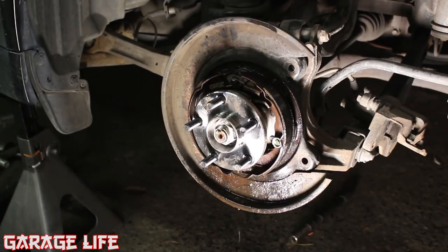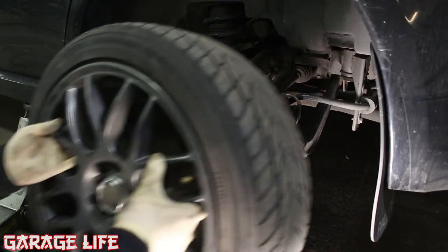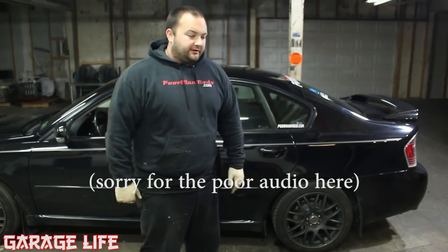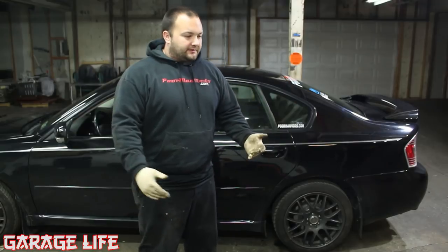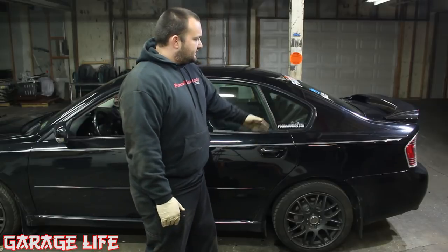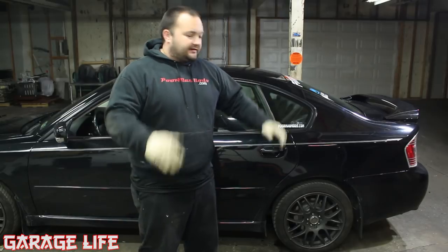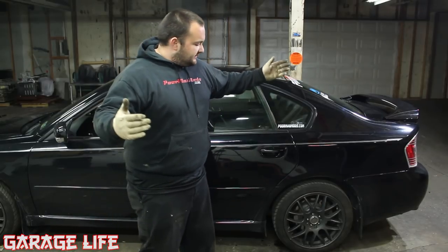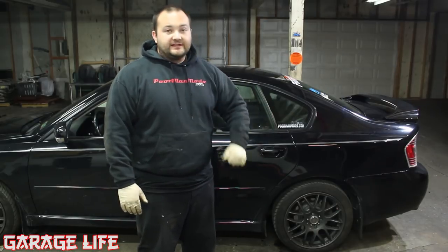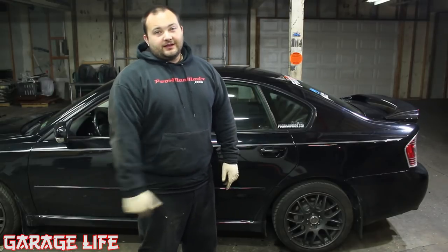Got everything back together. Now we're going to clean off the brakes with some brake cleaner to get all that penetrating lube off, then put the rotor and caliper back on — we're pretty much done. That's how you do a rear wheel bearing on a Legacy. It's probably going to be the same for a Forester, Impreza, and pretty much every Subaru of at least this kind of year. Really not that difficult; the most annoying part is getting those caliper bolts out. Now she's got her third new wheel bearing — I'm sure the one on the other side will go out in probably 15 minutes and you'll see another video of me doing another wheel bearing. Hope you enjoyed it and learned something, and I'll see you next time.